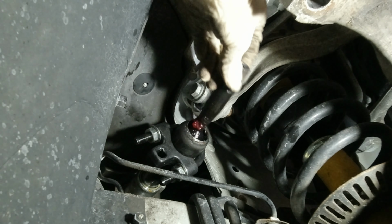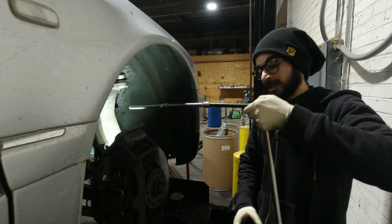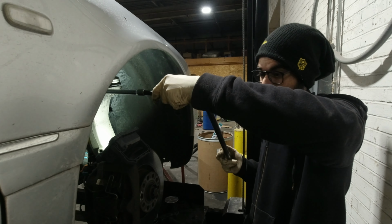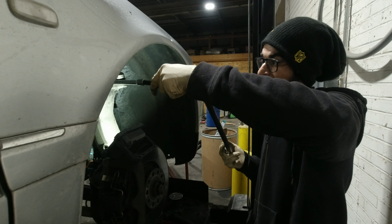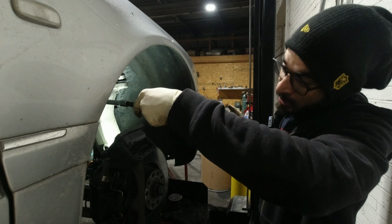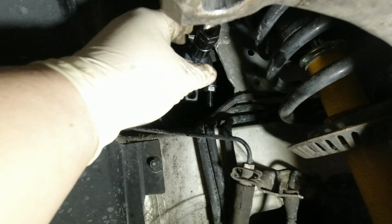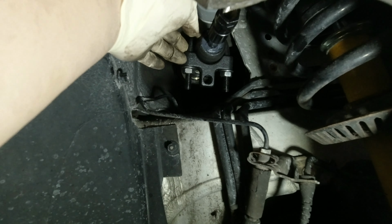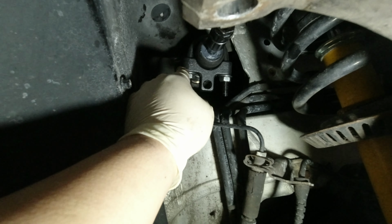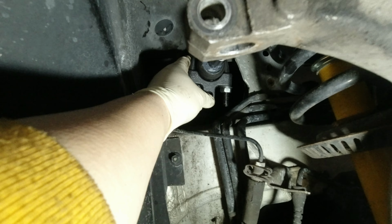and then you can remove it by hand. So I'm using 3 extenders, and you need to hold it firmly. That way it's much easier and much more comfortable to just move it, open it, and you don't have to put a lot of force in it. After we hand tighten the tie rod, you install this tool. Make sure you leave enough space so it can turn clockwise.